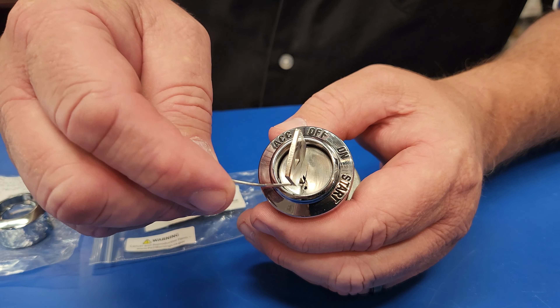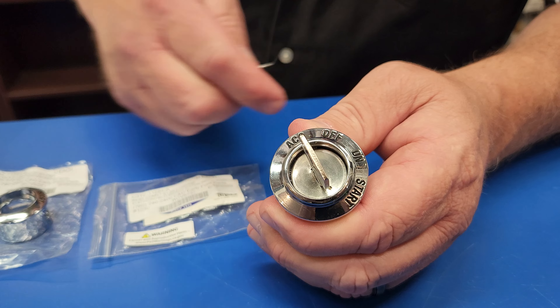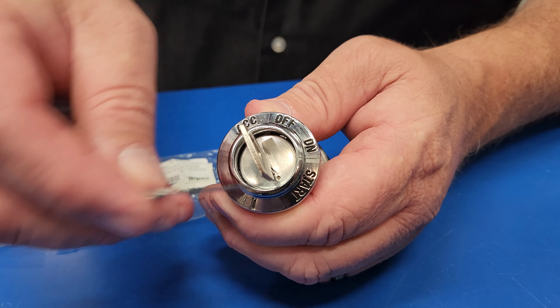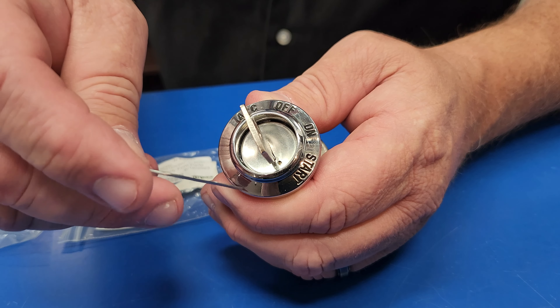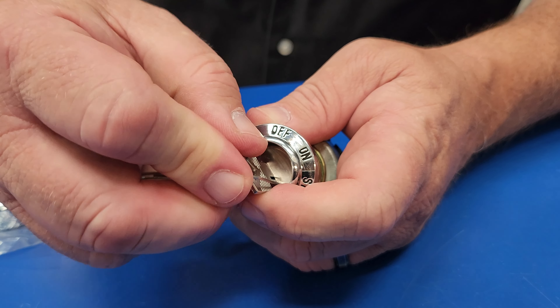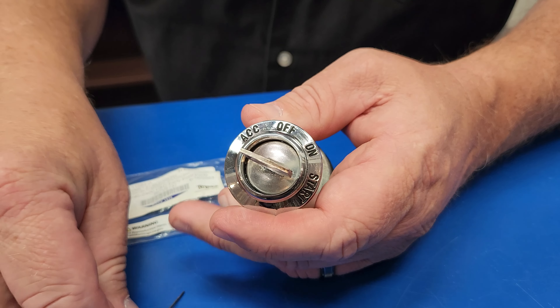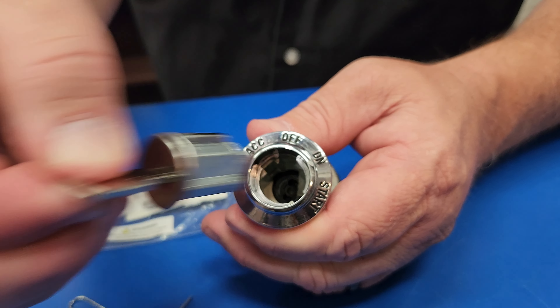Now a lot of these, the general easy way to do it — you have your key in the off position, turn to accessory, and you will see a small hole right below the key. This is the tool you need, just a paper clip. Push the paper clip in a little bit — it will be a little difficult with my hands in the way — but you'll see you turn the key a little bit further and the key comes straight out.